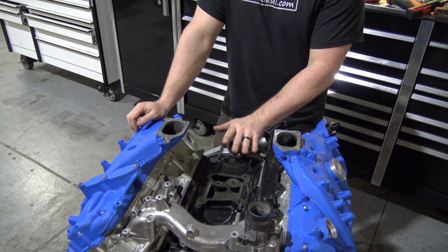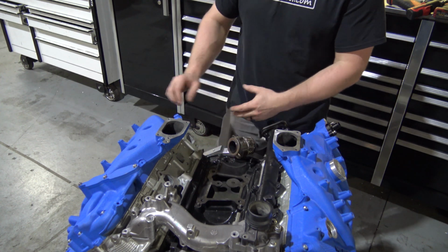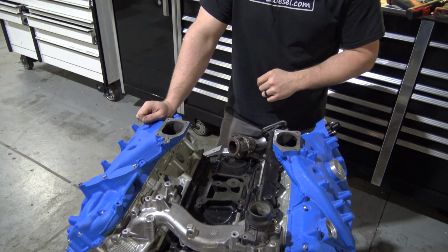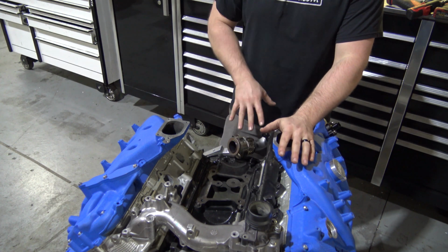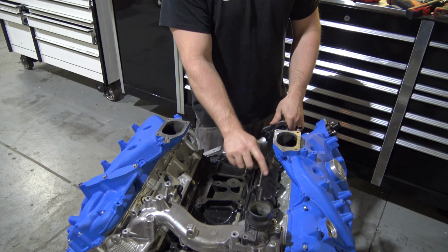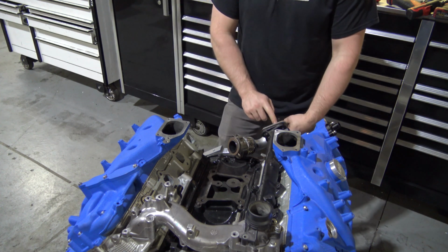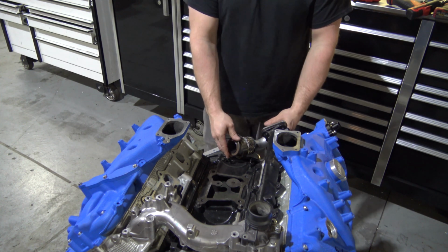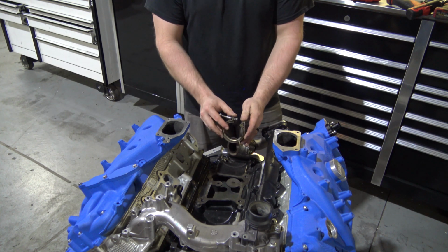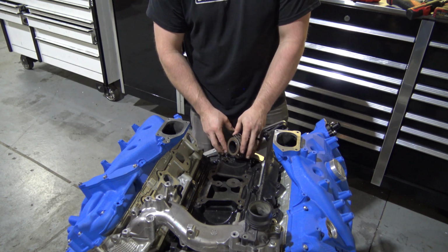Essentially, you're gonna need to get it down to this point. So the passenger side exhaust manifold is gonna need to be removed. You'll take that off. Obviously, the pedestal and everything will be out when you take the factory turbo out. And you're pretty much gonna be to this point. You will retain, on all models, the factory driver side manifold, and you will need a 15 and up style up pipe on the driver's side, and you will also need to retain the factory V-band clamp for the up pipe to the turbo, so that can stay on there.